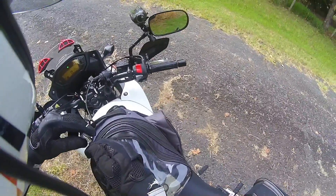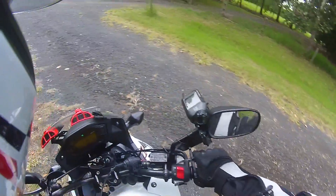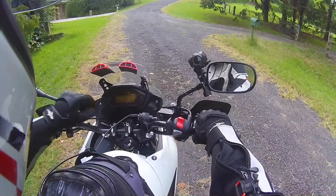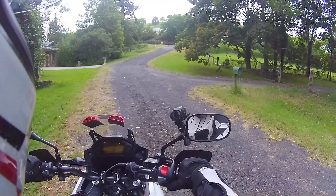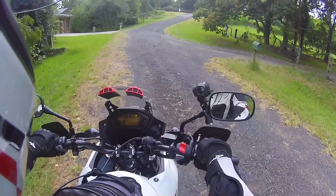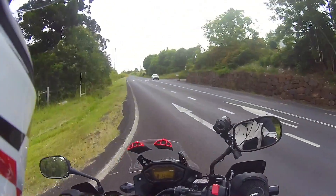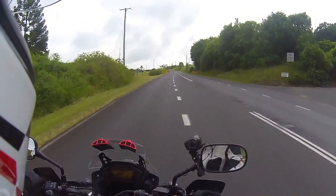At the moment the ABS is working, as you can see by the fact there's no little orange light on the dash. When the orange light comes on the dash, it's not working. Let's show you that. Going from the start, when you start to back up, the ABS light comes on and it stays on, until you get the bike moving and it all resets itself. There it goes — the ABS is now working. So for a bit of normal road riding, we want the ABS. We've got it.